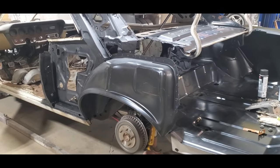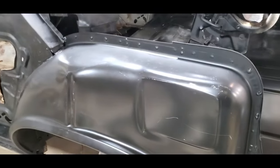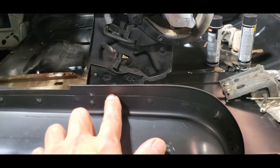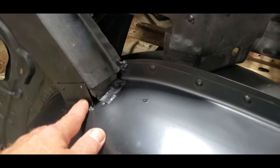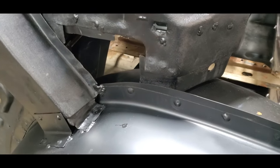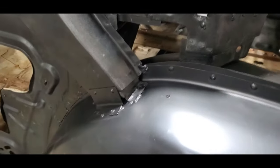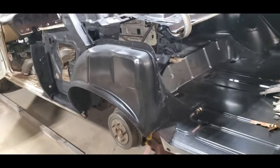It's really crucial that you get the wheelhouse to match the quarter panel, not the other way around, as it will cause undue stress. So what I had to do was put the quarter panel on, unclamp the wheelhouse, and then slide it down. You can see here, at least the way these parts were stamped, this is pretty far apart — that is actually an error in the stamping, the parts just don't match. But because this no longer was up flat against the bottom the way it's supposed to be, I bent these pieces down, made this up — this is all heavy gauge steel, everything's welded up the way it should be, so it's just as strong as the original. That is super important — not only that joint, but making sure you don't stress the quarter panel.